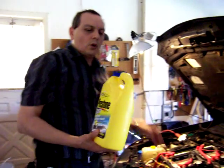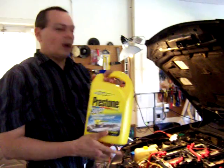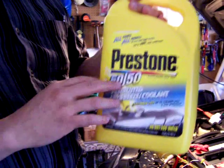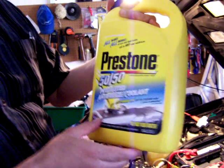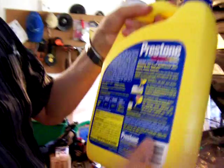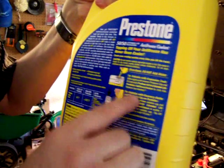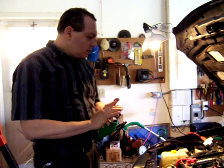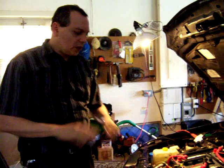I also want to mention that this controller is made of aluminum, so for the cooling system it's important — at least for this model — that it uses a 50-50 mix of aluminum-safe antifreeze. It has instructions here confirming it's safe to use with aluminum, so it's not just any regular coolant; it needs a 50-50 water and aluminum-safe coolant mix.